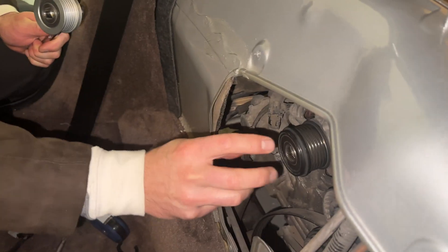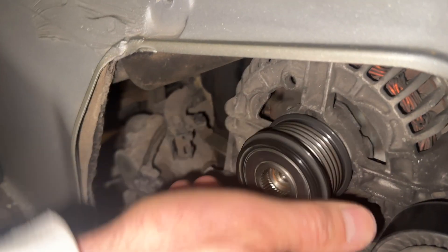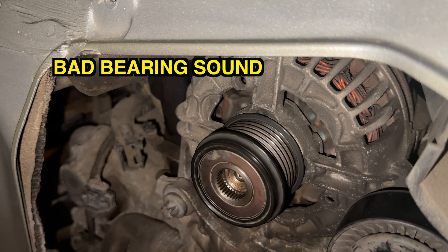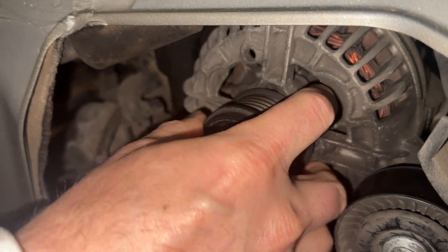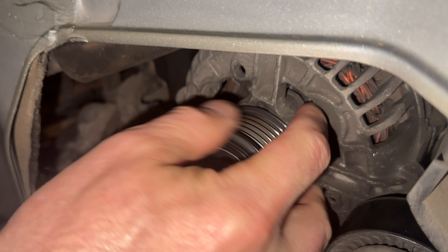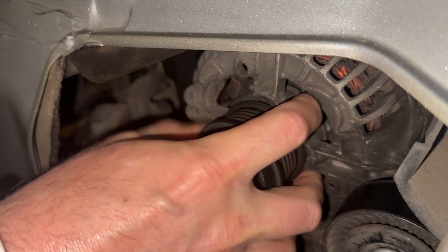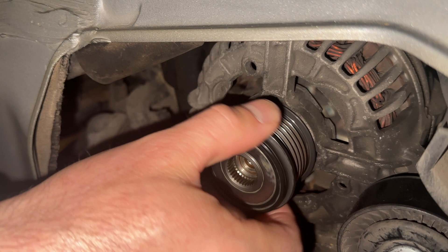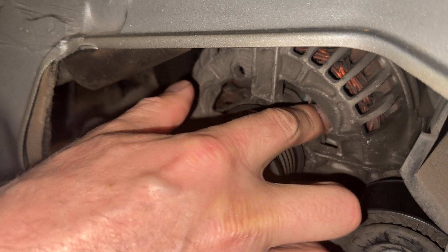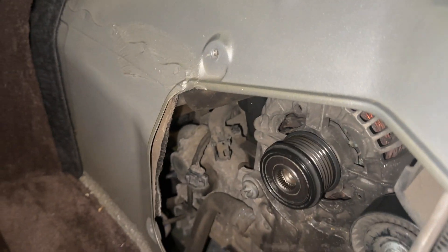Let's look at the new one. The old pulley goes that way, goes this way — any way you want — while the rotor of the alternator is stationary. The pulley slips both directions, and of course when the engine rotates the pulley, the generator rotor is stationary and no electricity is generated.